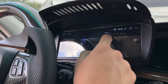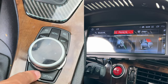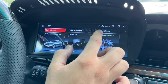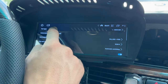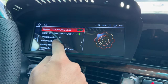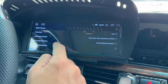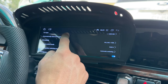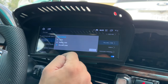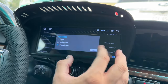We have a full Google Play Store where we can download apps, fire up YouTube, and watch entire YouTube videos if you connect a SIM card. First impressions - this thing is pretty sweet. The iDrive knob is very responsive with no lag issues, pairing with the new CarPlay unit perfectly. You'll need to head into the settings to format the iDrive system because it will look extremely bad out of the box. Go into factory settings and insert the code 8888.